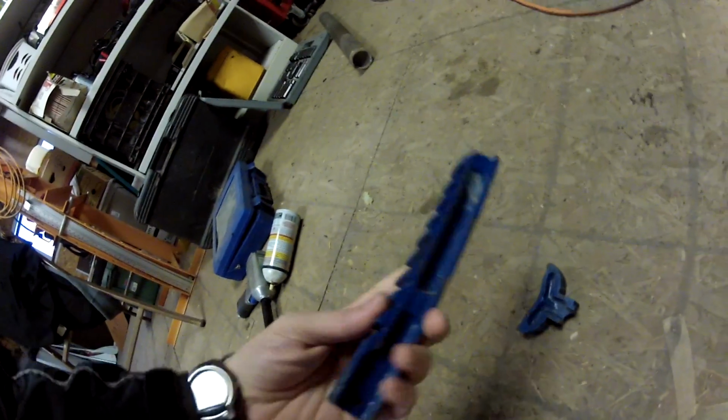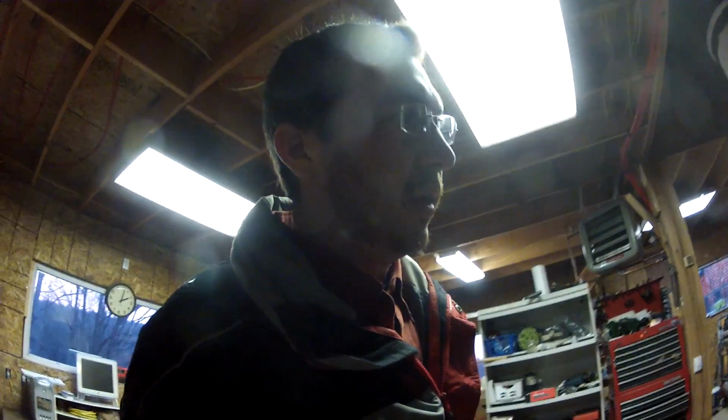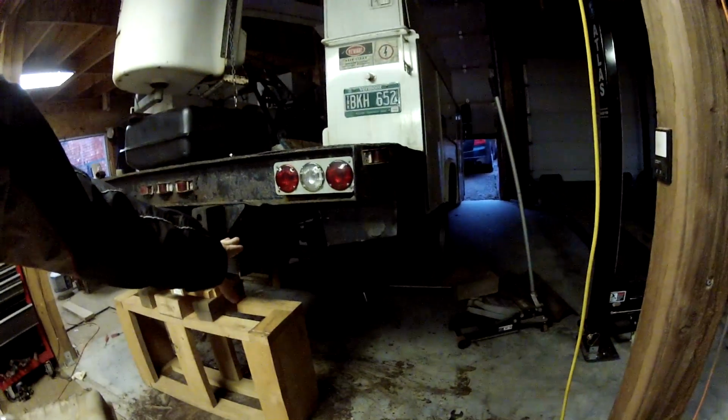Now, of course, I'm looking at this now, 2 ton, 4,000 pounds on that jack stand. The truck is 11,000 GVW, so that's how much it can hold if it's loaded. I would estimate the truck probably weighs 8,000, 9,000, which is why I'm not putting it on my 8,000 pound lift. I'm not going to try it. But anyway, it fell on the jack stand, broke the head off, and so I decided to not jack from the back, and I jacked from the sway bar. Jacked from the sway bar was way more stable.